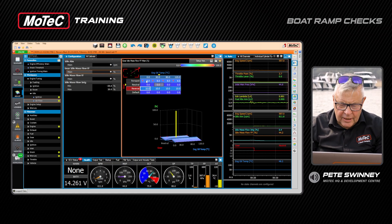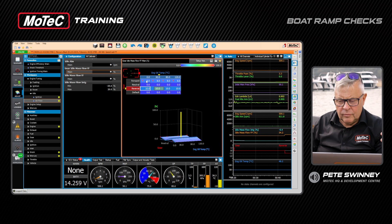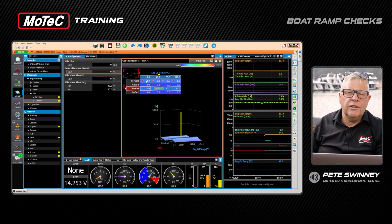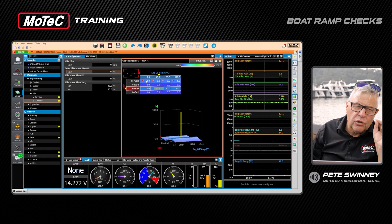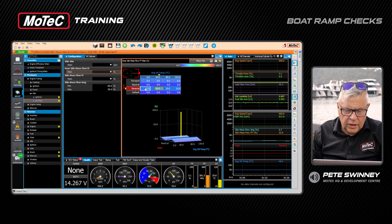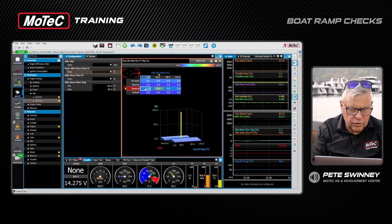Back to the reverse — I'm just highlighting the numbers ready and clicking back. It's not good to have minus 10 or minus 15 integral. If you get a different throttle body on there you're going to see some big corrections — we don't want those. Whenever it goes into neutral, forward, or reverse we want the throttle to snap to the correct position and let the closed loop fix up any little errors from there. That number's pretty good. We've got a little bit of negative coming out to fix it, so we can go across and do the same thing — normally the reverse numbers are a little bit less because the prop's not under as much load. Control-S to save where we're at.